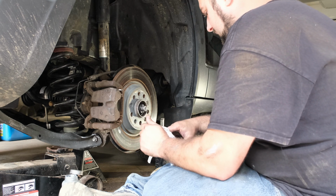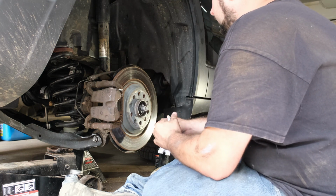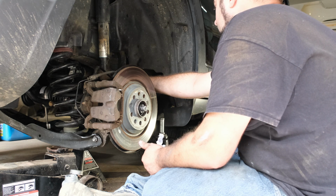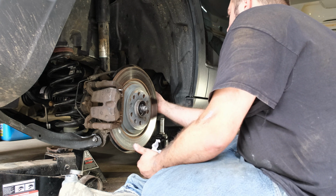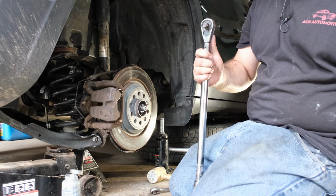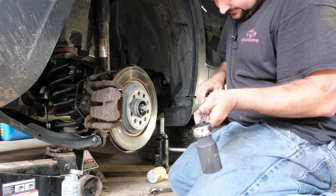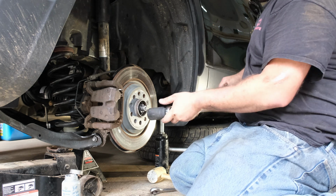service mode, and I set the emergency brake and I torqued this down, because then I can put the tire back on. Then we'll go underneath, we'll torque the lower shock mount bolt and these three 16mm bolts here for I believe it's the trailing arm, and we'll put the clip back into place for the brake line back here, and then that's it. We're done. So, there we go. So I have my parking brake set there. Oops, drop that. And we will start this guy off. We're at about 100 there.